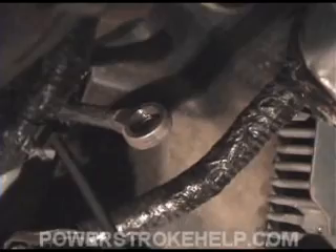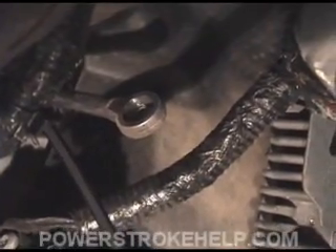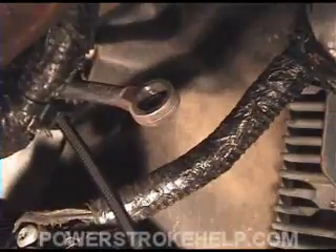At this point we're going to have to go up underneath the dashboard. You can do one of two things: either remove the clutch master — and it's an excellent time to do this project when you're replacing the clutch master. I'm going to go up under here with a cutoff tool and clip off the tip right here of the damaged end.